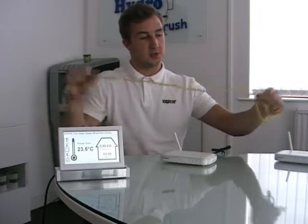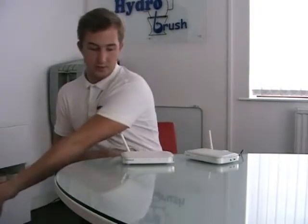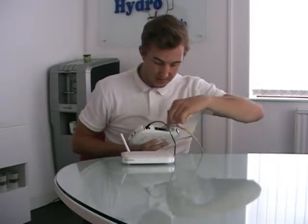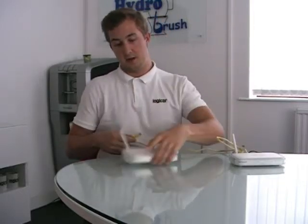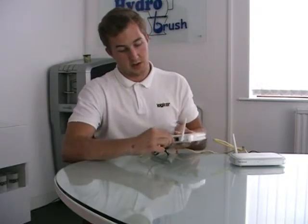The ethernet cable which comes in the box needs to be used to bridge the new access point with the existing router. I'm going to start by just plugging this into the back here where the existing cable is — stick that in until I hear a clip. And same on this side, I'm looking for port number 2, so I'll pop that in.